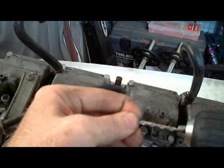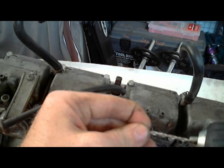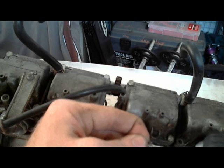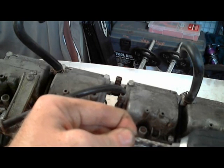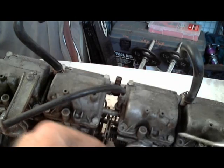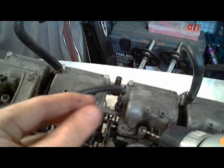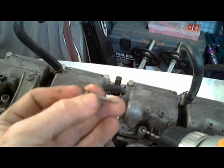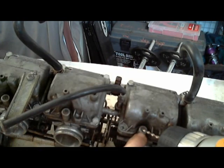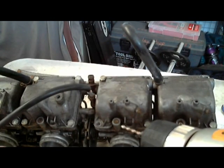So you can see the screw fits perfectly behind the drill bit, and you see the windings around the screw protruding out from around the drill bit, even though the shaft of the screw is obstructed by the drill bit. So that's how you want to pick it. You want to pick it so that when you do drill into this cap, you're able to put the screw in, and the windings of the screw will grab onto the little inside wall that you create. That's the diameter of the drill bit.